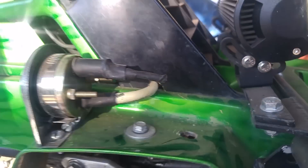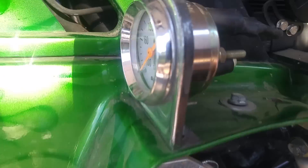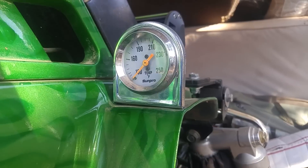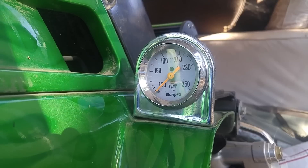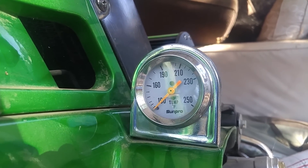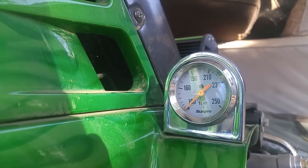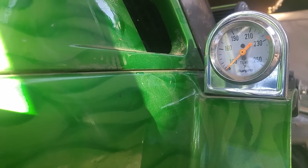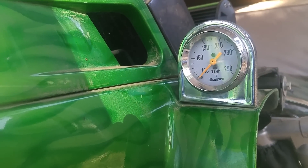A hose clamp holds the whole thing in the housing, and the housing is screwed to the fender. It's kind of a cheap, cheesy setup, but it works — it hasn't vibrated loose or anything. I can look down and easily see what my temp gauge reads while riding, and not have to stick my head underneath the motor like with some inline gauges. It normally doesn't ever hit over about 200 degrees while riding — it's usually around 190 to 195. If I ever see it go over 200 up to about 205, I shut it off and let it cool, or coast down hills.